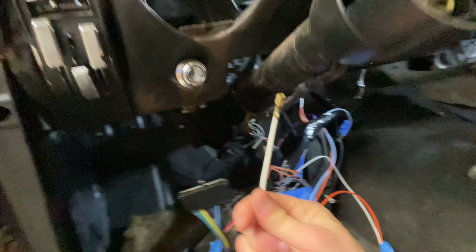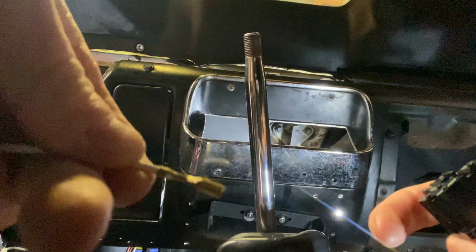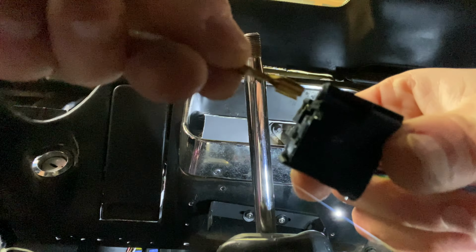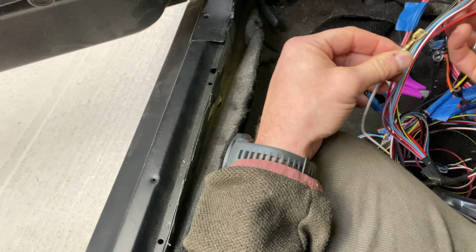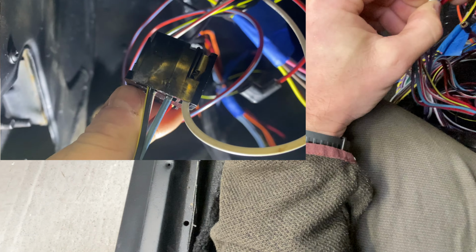Page 5, instruction 3, where it tells you to plug in the white wiper feed wire from the AAW dash harness. We need to identify where that wire is before we plug it in. Find it, and then plug it in on the back of the connection. You might think you plug it in on the front, but don't be mistaken. Plug it in on the back, as I show here. I forgot to show me actually plugging it in, so here's the finished product.